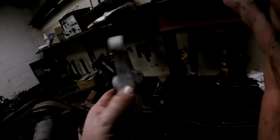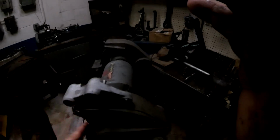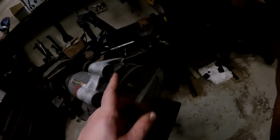You want to make sure you're in far enough to clear the seals, guys, because here's the thing. The cross inner bearing race, the shaft, or, you know, this part. I don't know if you'd call that a shaft or bearing collar. It's not really a collar, it's a pin. Technically it's a pin. So that bearing pin is going to go all the way across that surface, and it's going to stick out just about almost to the end, and then the seals are going to rest on the end of it. So you want to make sure these bearings are inboard of that.